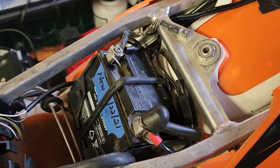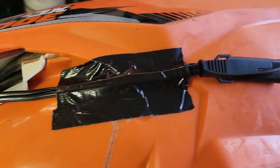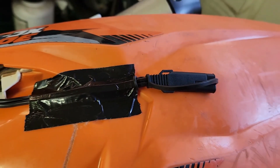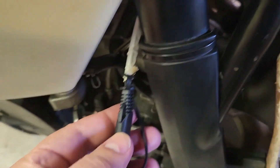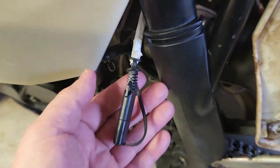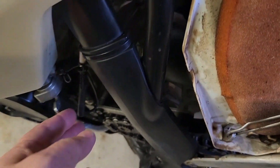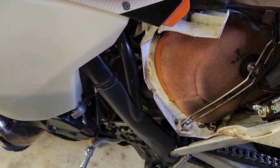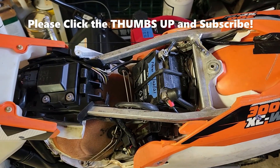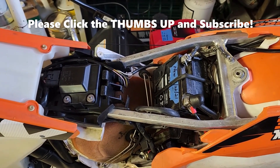I've replaced the lithium battery with a lead-acid battery because it just didn't need all the extra power of the lithium, and I've installed the charging pigtails for convenience. The primary battery connector is out the back of the rear of the seat, and the secondary I have just down here marked with some white duct tape so you won't make a mistake. Just to reiterate: you do have to charge this secondary battery separately because it will not be charged by the charging system. If this video was helpful, please hit like and subscribe — thank you for watching.